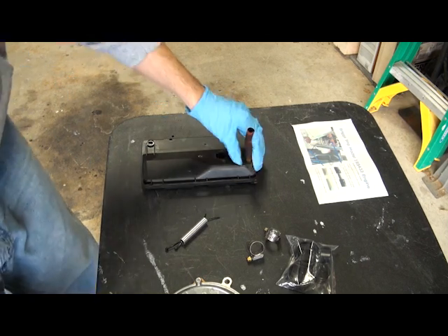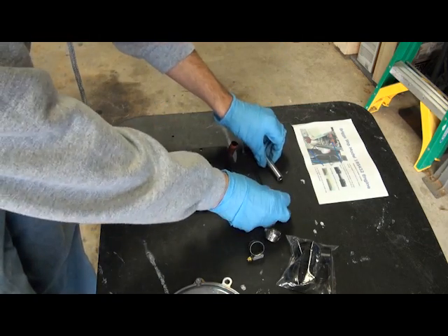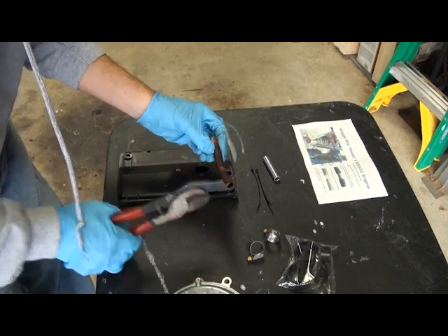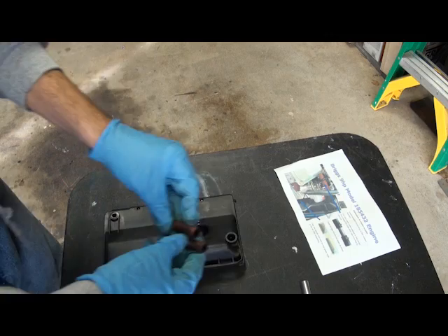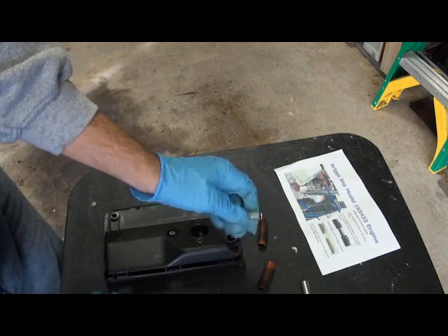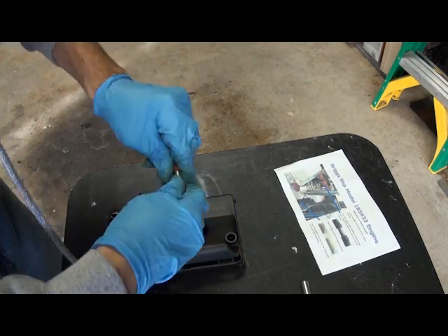Here's our air cleaner, and this vapor hose here isn't quite long enough, so the instructions tell us to use this little spacer here and these two wire ties to make it longer. They tell you to cut the hose about midway. So we cut the two pieces of hose and we have a little bolt-through spacer here to extend it.